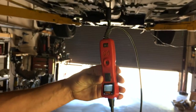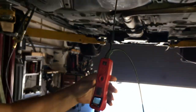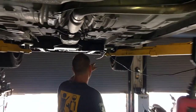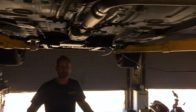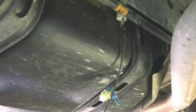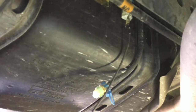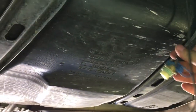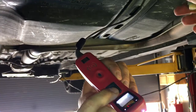This is a real handy tool here — it's called the power probe. We got this wire run all the way under the car, up to the battery, one on positive, one on negative. It's marked so you can't really mess it up. It's a very handy tool, but you also have to be real careful. You can't just go pushing a power probe into an engine harness or any kind of harness and start hitting power or ground, because you have the option with the toggle button. You don't want to just go poking in there — you could actually fry your computer.